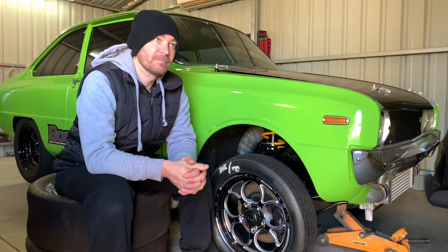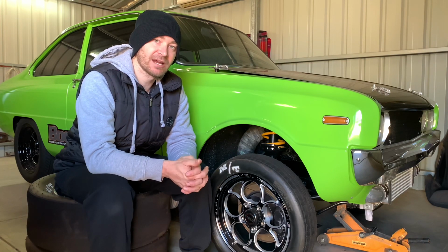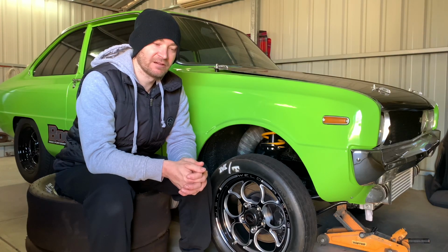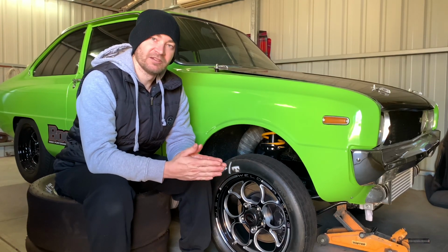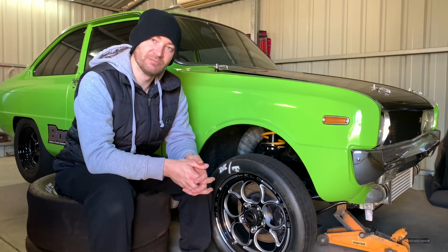And I got a phone call from them not long after I dropped the car off, so they could get it running, and they said the motor was no good. It had a cracked end plate and it was leaking a lot of oil underneath the engine after they had it running. So that was a completely standard Series 5 13B turbo engine. So I decided then and there I was going to have the engine built.